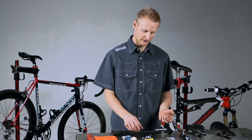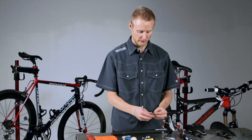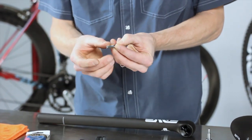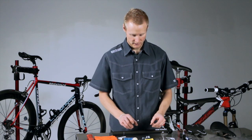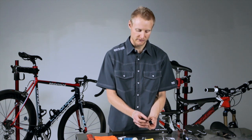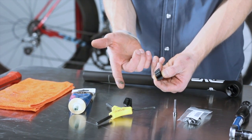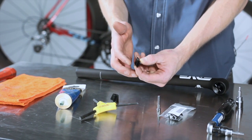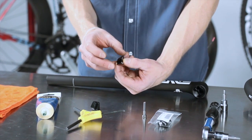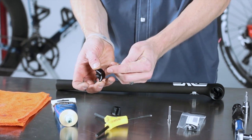This is the important part. You need to grease a couple areas of the seat post hardware in order for this to function properly. The first thing you want to grease is your bolt — take some grease and apply a dab to the bolt. Then grease the wedge, but only one area: the sliding surfaces. Apply a very light coating of grease. It's imperative that you do not get any grease on the outside of the wedge.